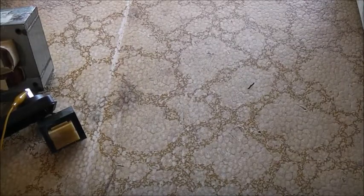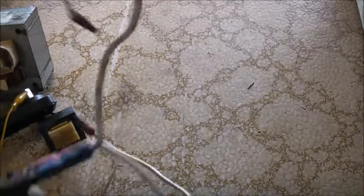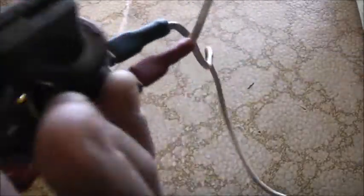I've been looking for this thing all over the place. This is a 240-volt solenoid coil out of a dishwasher — fits this ferrite core beautifully. I've got some nice little output on this; I think it was about a 6mm arc. But it arced over and it's potted in plastic too. That arced over — not happy. So, perfectly designed for this purpose and it arced over. I didn't get a video of it though — this was an off-camera experiment. Just wanted to share that for now, thanks for watching.